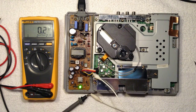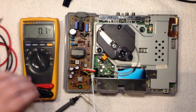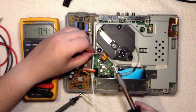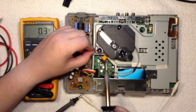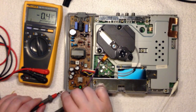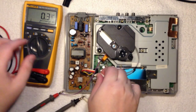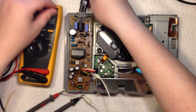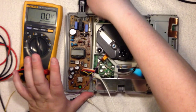Okay, so this proved to be a bit more difficult than I thought, so I will solder onto the flex here. So I'm unplugging power. Okay, I've pre-tinned this wire. Let's just move this out of the way first. Temporarily put it like that inside this. If I move it, everything will go away, so I have to be careful now. Now let's attach power. Be careful again. Don't press here because they have live connection. So let's go.